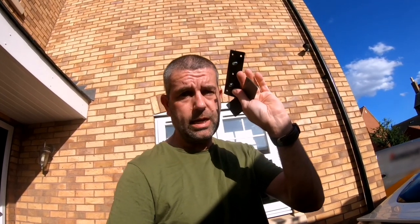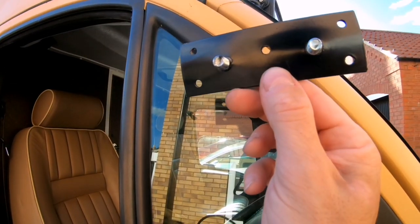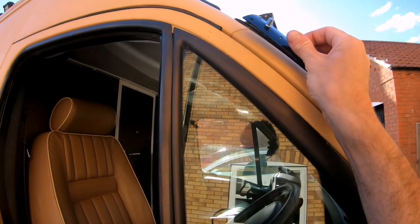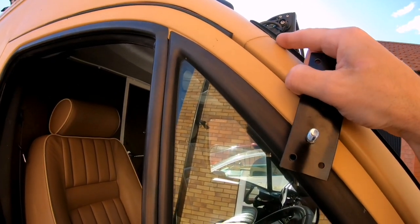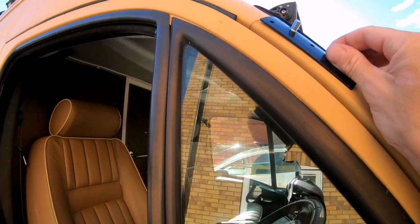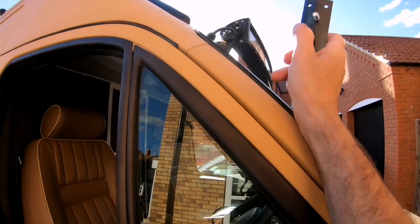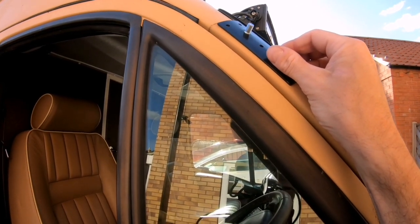In the kit you get two mounting brackets and the foam underlayer — that's to stop water from penetrating. You've got five screw holes there. Looking at the instructions, the mounting bracket wants to be fitted onto the pillar here. There's a seam from the roof to the pillar, and it shows the bracket sitting just below that seam. Because I've got the light bar fitted there, I may have to play around with the height settings of this sunshade.